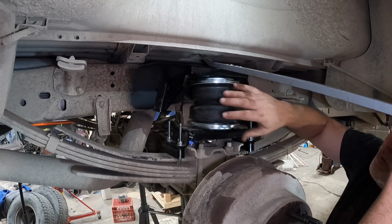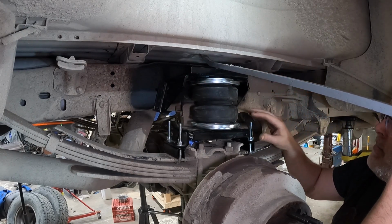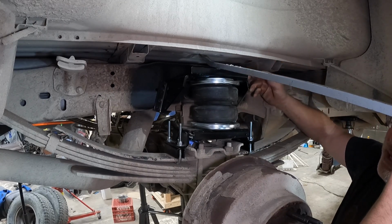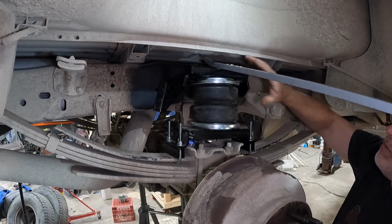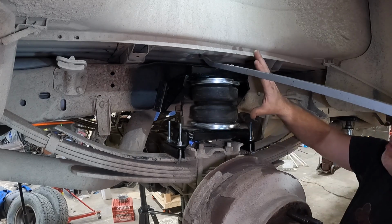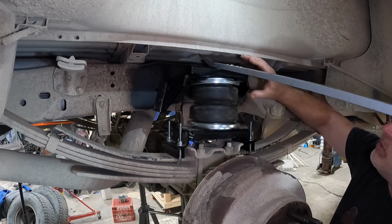One other tip, before you mark and drill these holes, make sure there's nothing on the other side. As Christian reminded me, on the other side, obviously you're gonna have brake lines and fuel lines. You're gonna wanna move all that stuff out of the way, and it's very simple. We chose to do this on the easier side, but we will show you after we finish the other side. We've got it in place. We're using a long pry bar, and I'll put links in the description for all these tools.